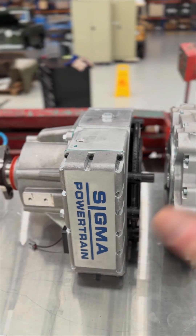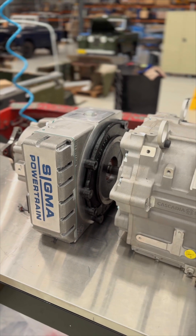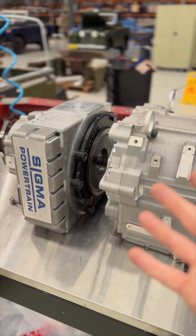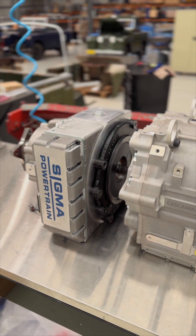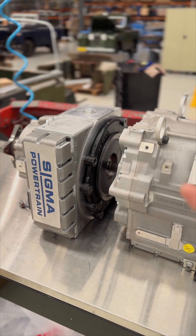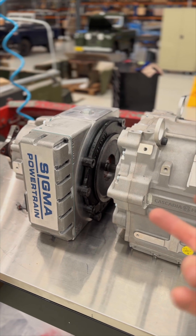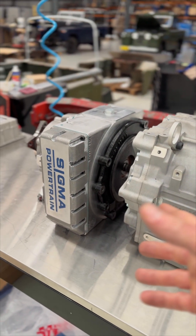It's a bit of a common misconception that EVs just don't have a gearbox, don't have gears. They're automatic in the sense that you don't have to change gears, but it's not just a single reduction gear. It is often, in many cases — say the Porsche Taycan — that has two gears: a gear for really great acceleration and a gear for more efficiency at top speed.